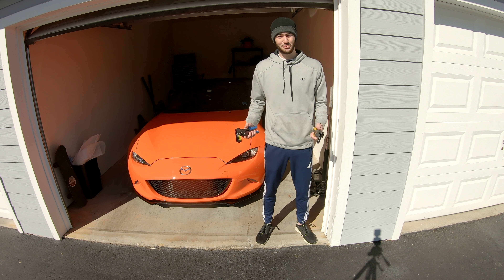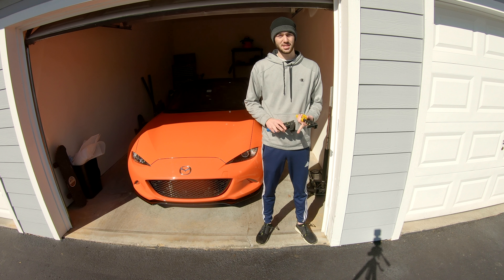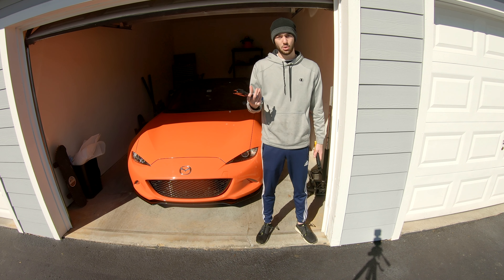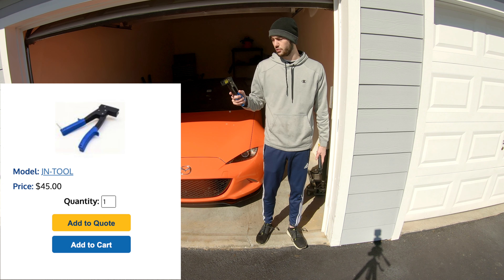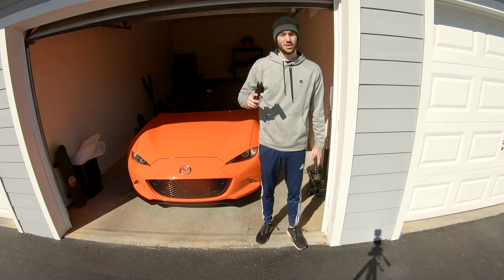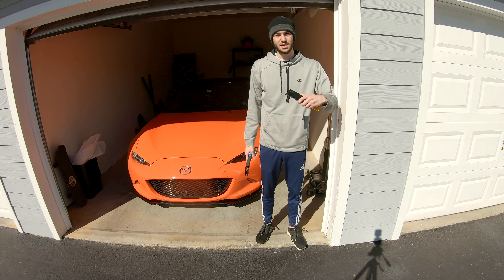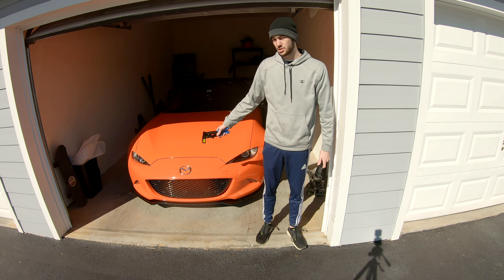You will need two specialty tools besides a drill, drill bits, and general screwdrivers. First, you will need a jack nut installation tool — this installs jack nuts along the bottom of the car, which is what holds the appearance package pieces onto the car. I picked this one up online for about $45, and I'll add a link in the description. You will also need a hand riveting tool, which was only about $5 at Harbor Freight — there are a couple of rivets to install for the front splitter.